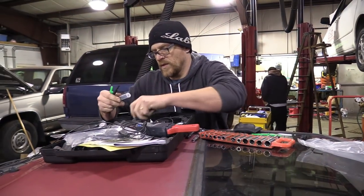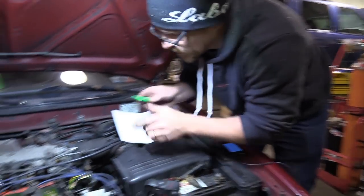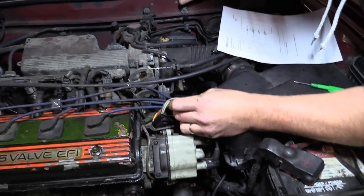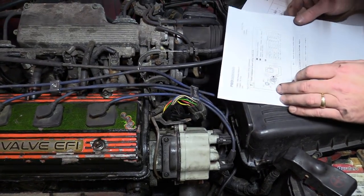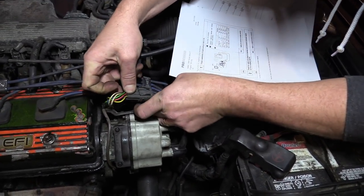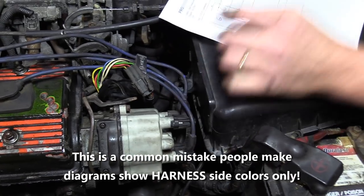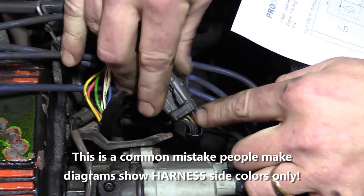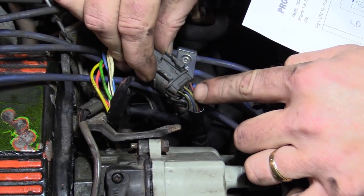You get to see a little bit more of the Uscope in action — this kit's pretty sweet. It should be red and blue. The wire colors weren't clear so I got a picture of the connector. The red here turns to green on the harness side, so the colors on this side do not match — it's the harness side colors I need to go after. I'll use the back side. Red and black — on Toyota, L is blue. These two should be my NE signal.